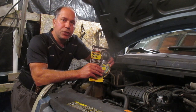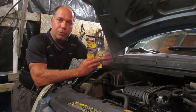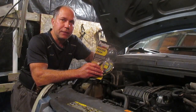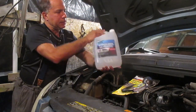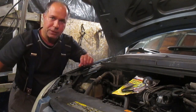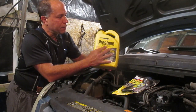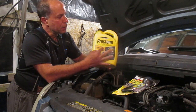In today's video we are going to add engine coolant to the radiator system and we're going to use this little tool here to make sure that the coolant ratio is 50/50 — meaning 50% coolant or antifreeze and 50% distilled water. Deionized water like this ensures that any minerals or chemicals from your house water are not getting into your radiator system and causing build-up. This antifreeze plus coolant is already a 50/50 mix, whereas a plain container of antifreeze has to be mixed with deionized water.